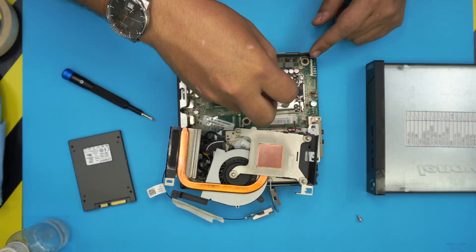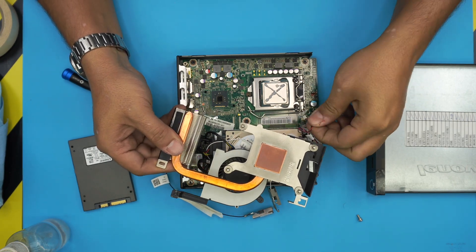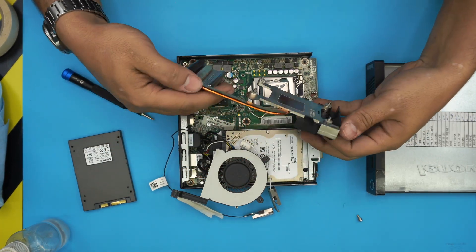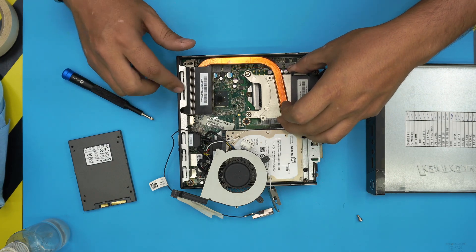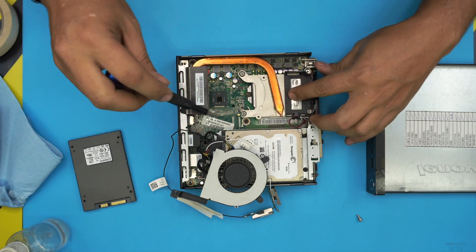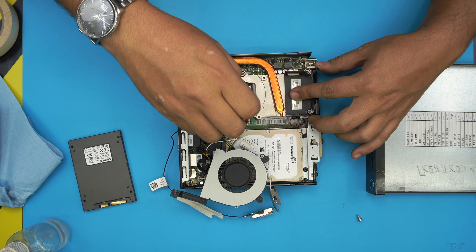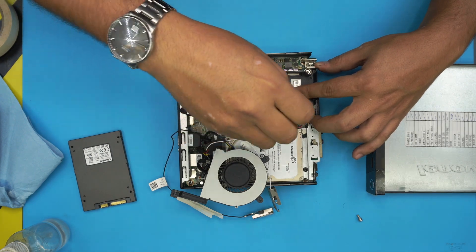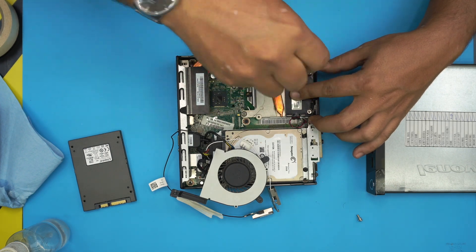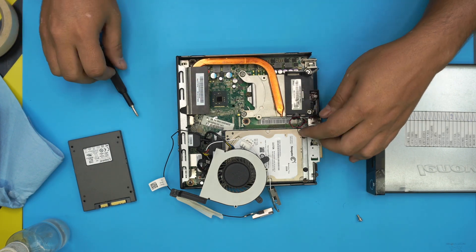Next, plug in the speaker cable first, then rotate the heatsink and slide the heatsink side under the case, bringing it over evenly. Don't lift it — instead, cross-stitch the screws: tighten this side a little, then the opposite side a little, then the other sides, continuing until fully seated. With two rounds you should have it locked down in place.